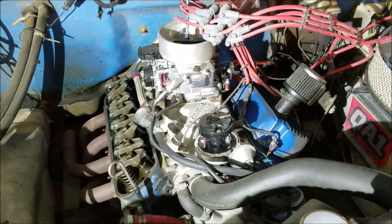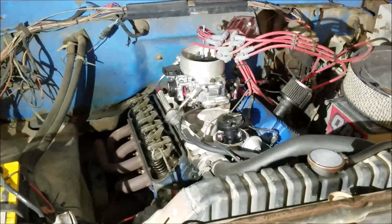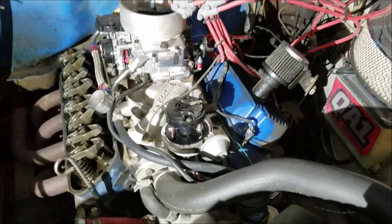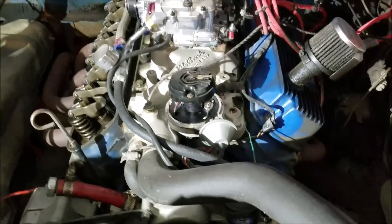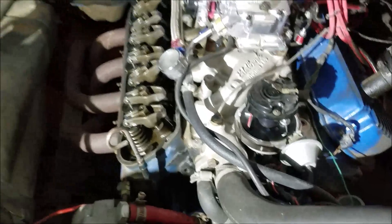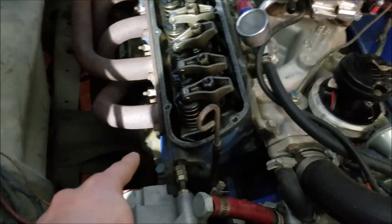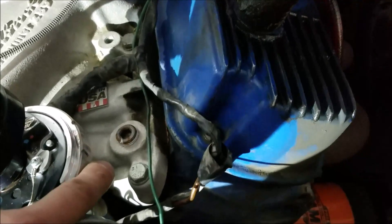So I figured we'd make one last video hurrah with it before it was all said and done. Today I want to talk about three ways to find top dead center on an engine, and it's really pretty simple to do. The first one is if you do have a distributor in the car and you're trying to time things up — not necessarily where you just built the engine — you first want to locate where your cylinder number one is. On this old Ford small block, it's up on the passenger side on the front, so you're going to want to trace your plug wire around, find where it's located on your distributor cap, follow it down to your distributor base, and make a mark.